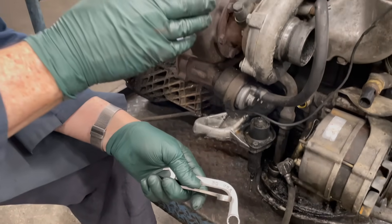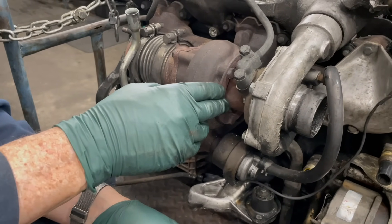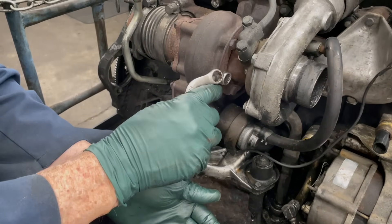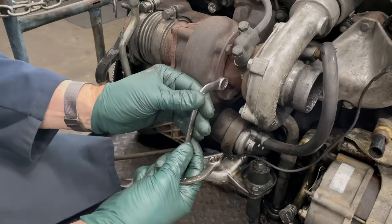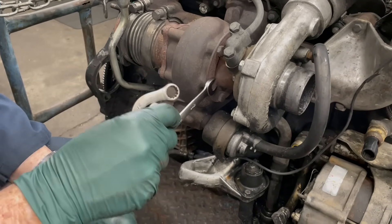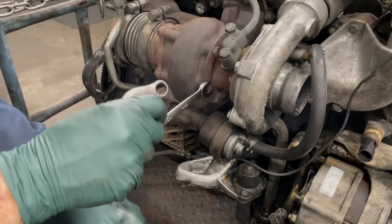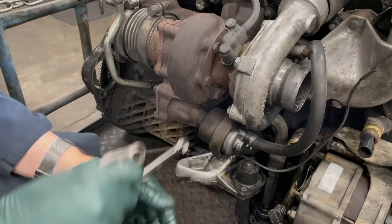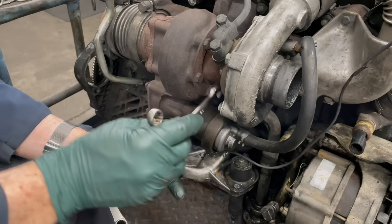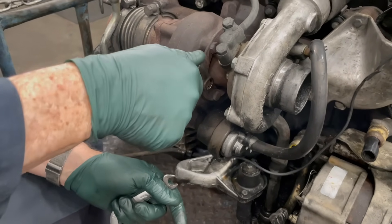The reason there are two sizes is the Garrett turbos are US-made, so they're not metric. Now granted you can get a 13mm on these bolts, but notice it's loose — and if you're going to use an open end on some of these, that's just too loose and you're going to round out the bolts on this turbine housing. So look at how tight the half-inch goes on — see, that's real tight, and when you put the box end on it's much tighter.